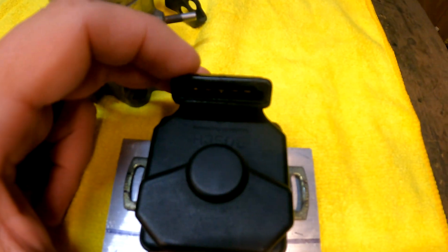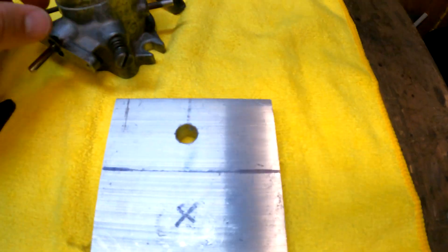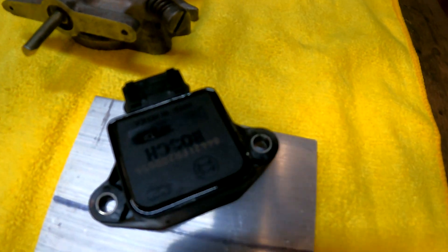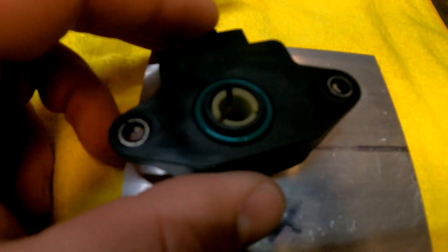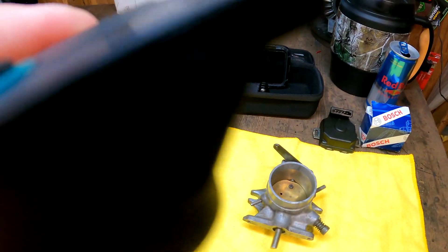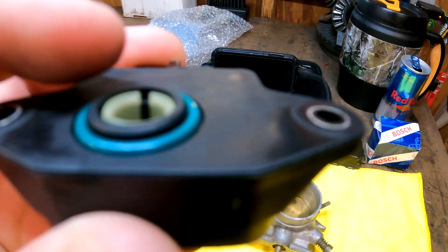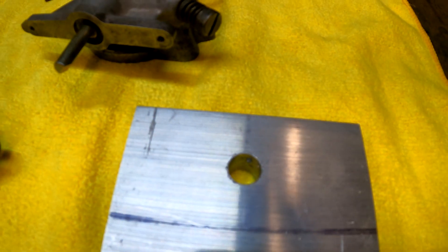I may take the stock piece and mark out some slots so I have a little adjustment. The stock sensor requires some adjustment, and then we will just get this in place. There's enough thickness here that we will just tap this for M4. Our first step is to get this center bore big enough to go over the shaft. Inside the new sensor there is a little O-ring and a raised section — this is 15 millimeters — so I'm going to countersink a slightly larger hole here.